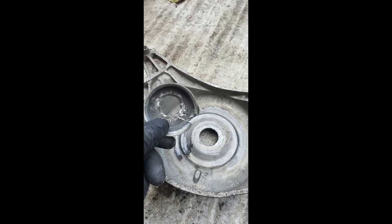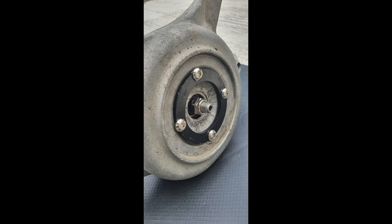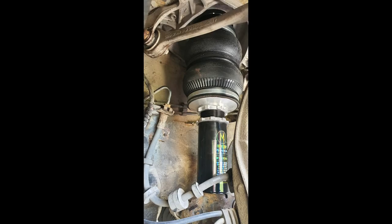You need to remove that collar. Once that's been removed, you need to drill four holes which then locate on top of the pillow ball mount themselves and fix it together. Once you're happy with that, you can refit the strut to the car and that should be it. Thank you for watching, hope it helps.